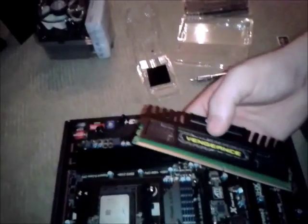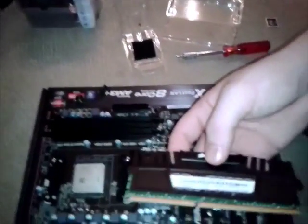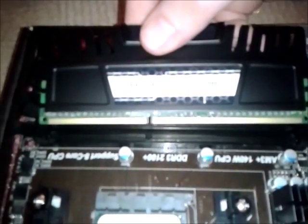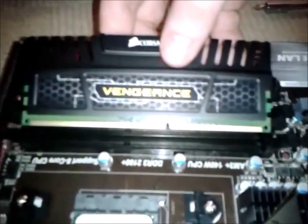If you've got cheaper RAM it won't have this heatsink, and it'll look different depending on the product. This is a DDR3 RAM stick — you can't really get DDR2 easily anymore, and DDR3 is now about the same price but a lot faster. There are some little notches in the RAM slots. If you line up the RAM stick you can see where the notch lines up, and if you rotate it, the slot doesn't line up — so if it won't fit, do not force it. Same as with the processor, you will break it. To fit it, you literally just line it up with the slot and push it gently, pull the clips in, and you're done.